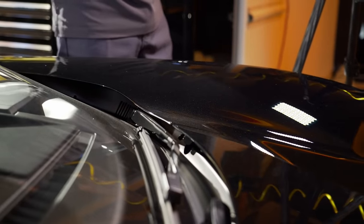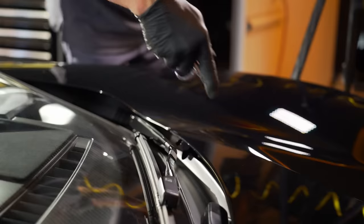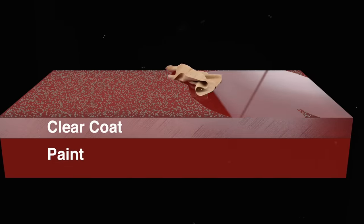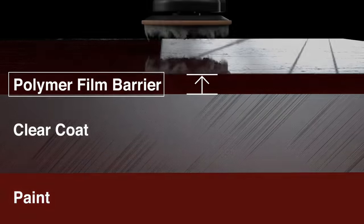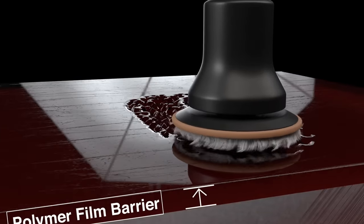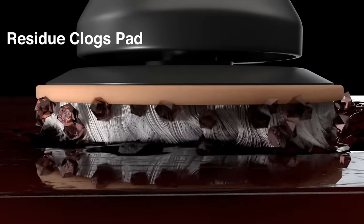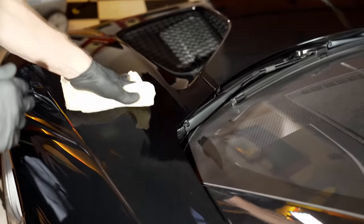The quickest way to remove dust is to use clean compressed air to blow it away, but be careful not to blow the dust on other parts of the car and chase your tail in circles. Most people, however, choose to wipe the light dust with a spray detailer. Although this too is quick and easy, it tends to be the source of most issues for many detailers without them realizing the problem. Some spray wax and spray sealants, commonly called spray detailers, contain polymers and various protectants that create a barrier layer on top of the clear coat, which blocks or interferes with the compound and pad touching the clear coat when buffing. So be conscious to avoid unintentionally adding contamination yourself when trying to clean the dust off prior to buffing.